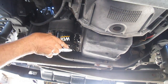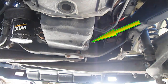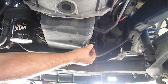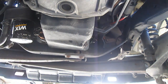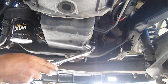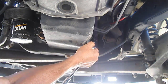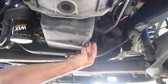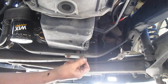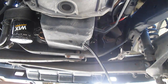Now the next thing is let's drain the oil. We've got our pan under there. Let's see what size this is — that is 9/16 inch. Remember, when we're taking it off it's counterclockwise. Now, this oil is going to go out this way but it's also going to drip down, so make sure you've got the pan set over there. And there it comes — we'll just wait for all that to drain off.